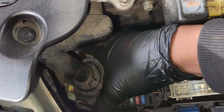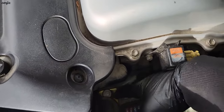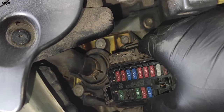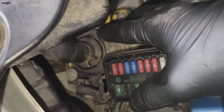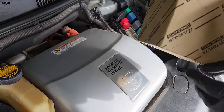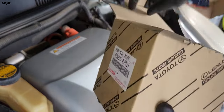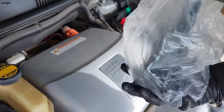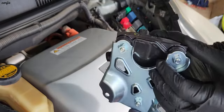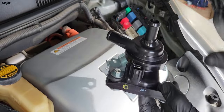In this area you can smell a burning smell. This is the inverter and the cooling pump — this one has a short circuit, which is why it keeps blowing the 15-amp fuse. This pump is internally failed — it's not pumping coolant for the inverter, so the inverter gets hot and blows the fuse. We need to replace the inverter cooling pump to fix the problem. It's very smelly in here, like electrical burning. The pump has an internal short circuit, so we need to replace this part.